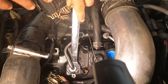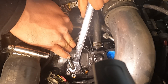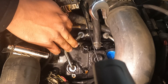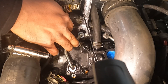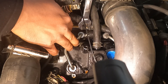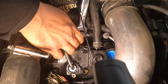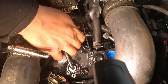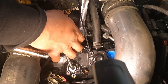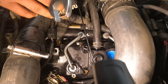I'll cinch it on in the front, cinch it down in the back a little bit, then back to the front. This is going to hold the injector line without over-torquing it. I want to torque it to about 33-35 foot-pounds — that's not too much, so I don't want to go crazy. You can kind of feel it seat as you go.